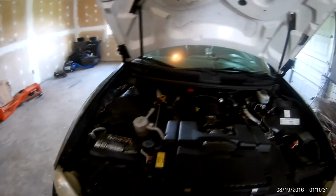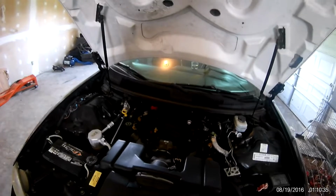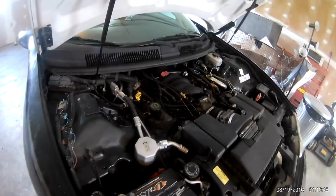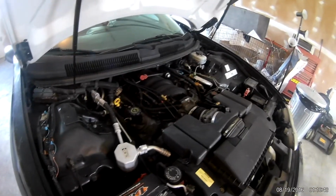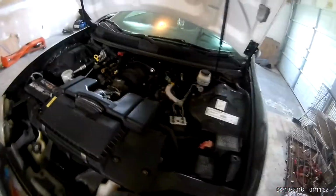All right. So here's the engine. It's a standard LS1, nothing too special. LS6 intake, 241 heads. Still got the stock exhaust manifolds on there. The only mods I've done is I built the transmission, 3200 RPM FTI Street Brawler converter, and that is a locking up converter. And I did a muffler delete because it's a really good way to free your exhaust up without really spending any money, because it just turns your muffler into pipes, which is what you want to do.